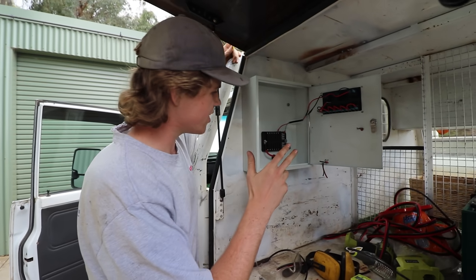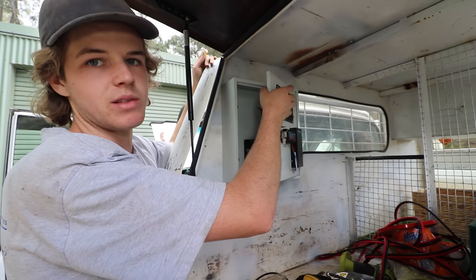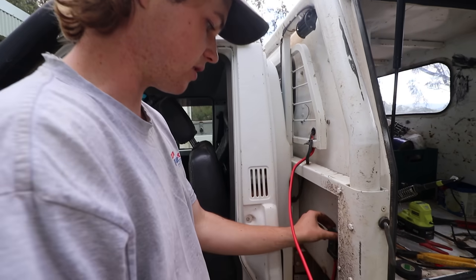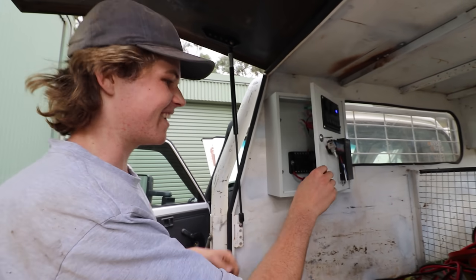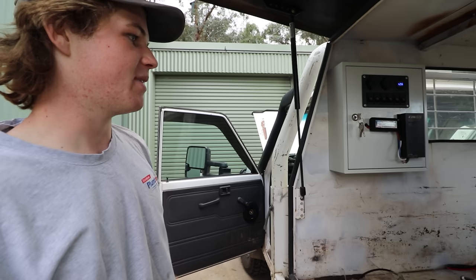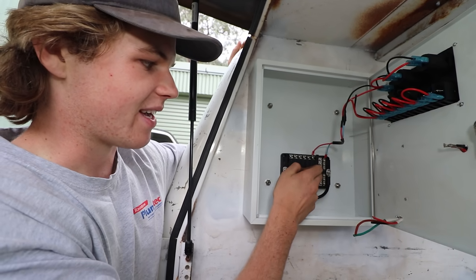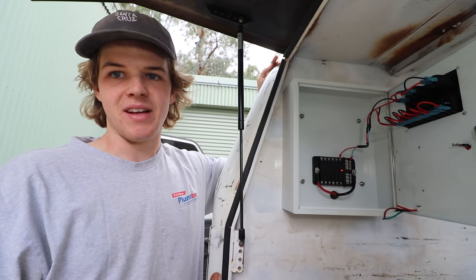As you can see, a little bit's changed — got wires coming in through a grommet. They just go onto the positive and negative terminals here just for testing. We've just got the top things wired up, got our fuse — just going to use a 20 amp for testing purposes today. We plug the Anderson plug in and we should have power. The fuse block also has LEDs in the middle — if a fuse blows, the light comes on. It's a quick way to easily identify if anything stuffs up — you don't have to go looking around for what's broken.